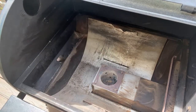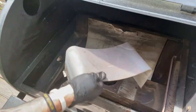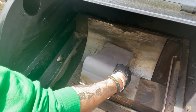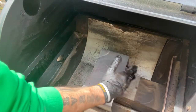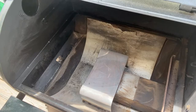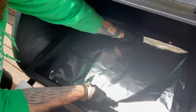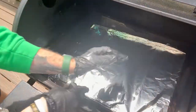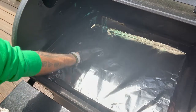Next step is cleaning your grill grates. Put the fire pot cover back on — it's very simple, just take the little clips, slide in one side, and pop it right down. Then put the grease pan back in with new tinfoil. Make sure it locks in place and isn't sliding around. You want the long end facing down so everything slopes and drains out properly.